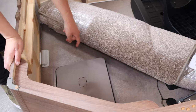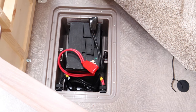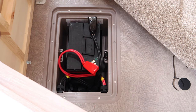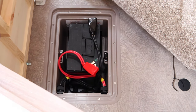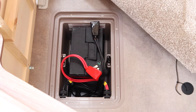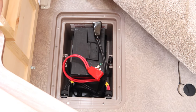In this Vigo model, we have the battery just below. I highly recommend getting at least a 110 amp-hour battery — this is if you have a motor mover and a reasonable single-axle caravan. Without a motor mover, you can probably get away with an 80 amp-hour battery if you're not going off grid. However, with a twin axle with possibly quad movers, I suggest a 130 amp-hour battery.